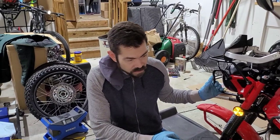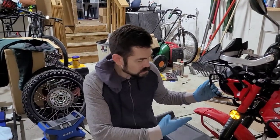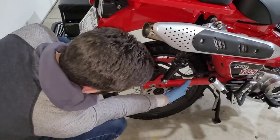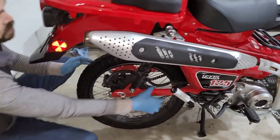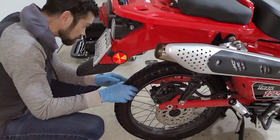As you're putting in the rear wheel, once you get it past and chain back on it, go ahead and raise that front a little bit more so everything is safe. I've already got the brakes back on the little slider that it has up front here, a little peg. Get it all lined up so it's nice. I've got the tire centered pretty well.